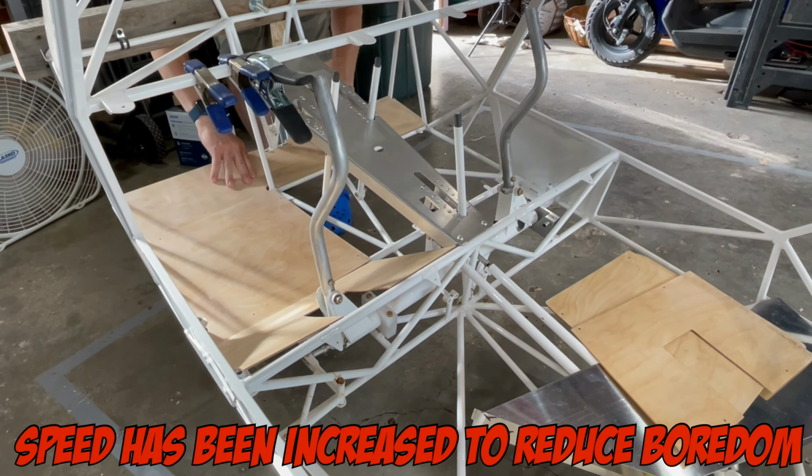All right, 12 to 15 inch pounds three times. So get that wrench on the back side there. I could only get it hand tight the first time, so it's going to take a few times to get it over 12 to 15 inches. But 12 to 15 inch pounds isn't that much, so about another turn, I think. And there's 10.